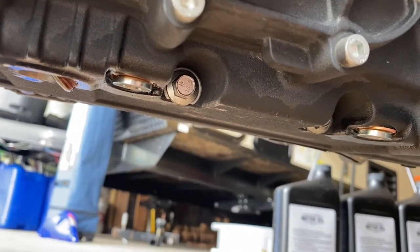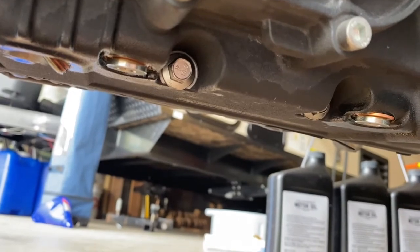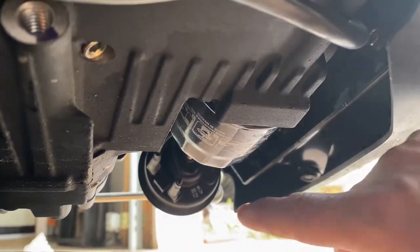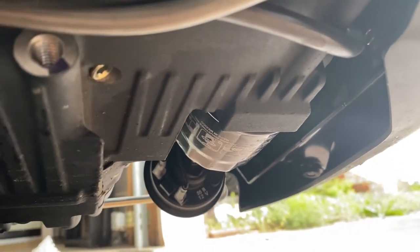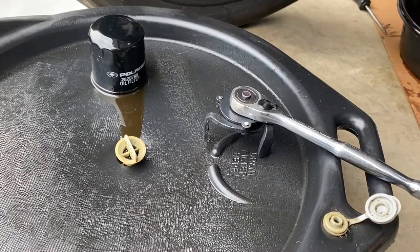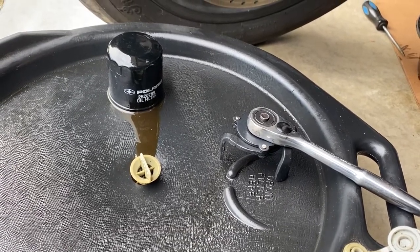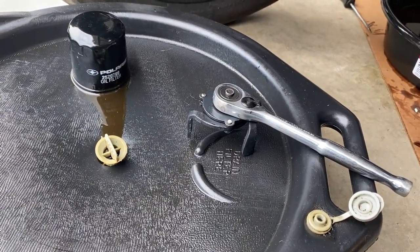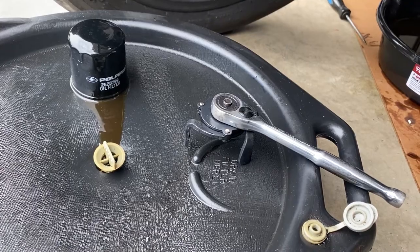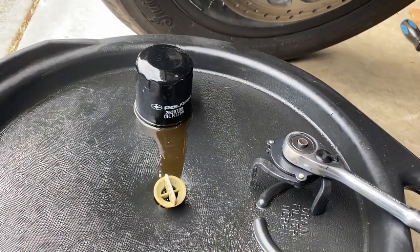Next, we're going to take off the oil filter. Usually after I take the oil filter off and drain the oil, I like to take these drain plugs off once more just to make sure any excess oil drains out. The oil filter is located near the front of the bike — right there is your horn. I went ahead and got the oil filter off. Make sure you have the appropriate wrench — I believe this is a 64.7mm size. I picked up this adjustable filter wrench, which adjusts from 63.5mm up to 98mm. I can put a link in the description, but it worked quite well.